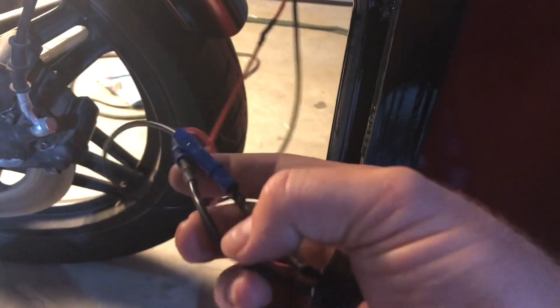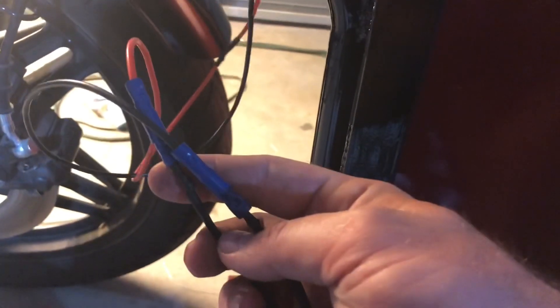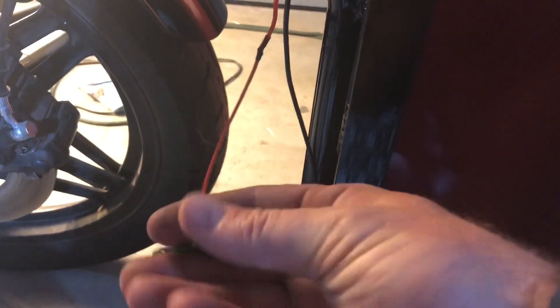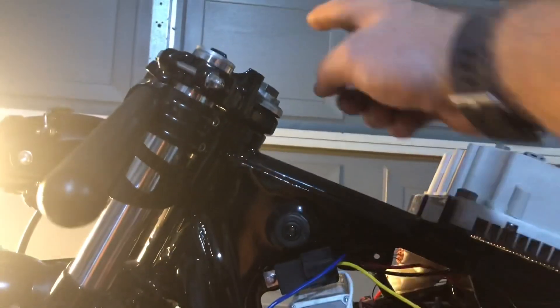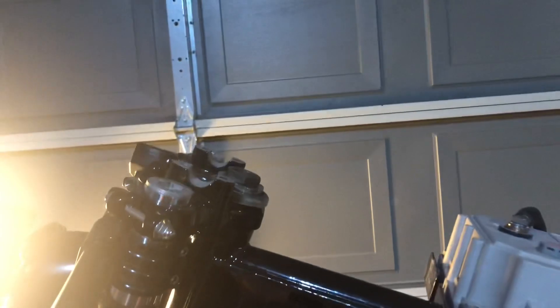For whatever reason, that ignition switch didn't work with just the black and red wires, so I've gone ahead and quick-disconnected it and put this back on. I'll troubleshoot another day - it's a little bit late, but at least now when the other guy wakes up tomorrow this will turn on for him. I'm still going to install a 12-volt to 5-volt converter and stick that on one of the free wires here - that'll allow us to connect the 5-volt USB connection for the display. I'm not going to do that today though; I'm going to do the fiberglass next, I think.